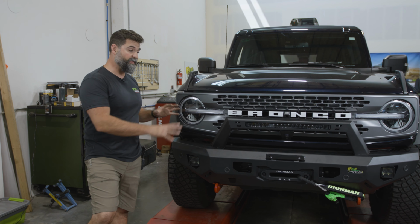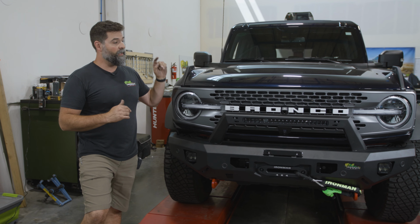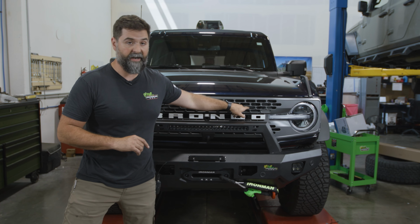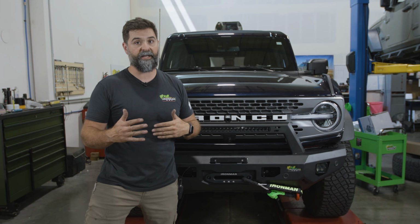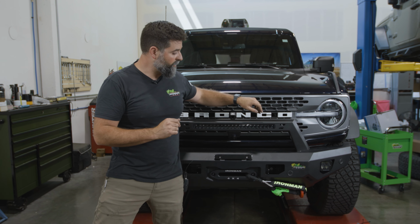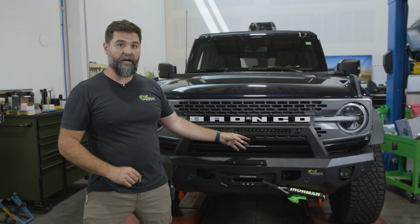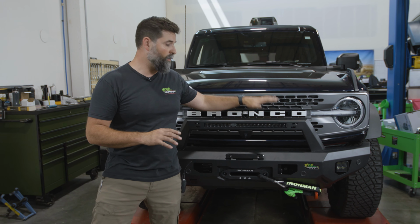Couple things. Now that everything's tightened, bolted on your truck, you're going to want to get out and run. But we need to make sure that after we relocated that adaptive cruise control, take it out on the highway, run it at a couple different speeds, make sure it's not too sensitive. If it is, angle it up. Not sensitive enough, angle it back down a little bit. Also, your front camera's been relocated, it needs some time to run around and retriangulate itself. You should be good, but you wanna make sure everything's working.